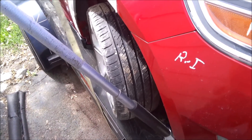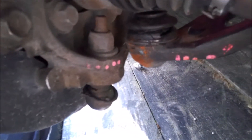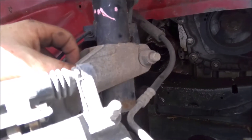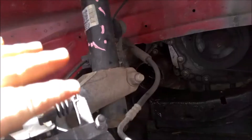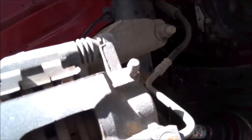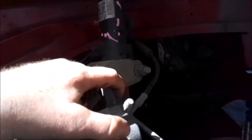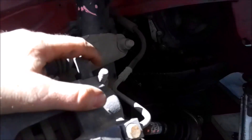Here's the carnage: we got an axle popped out and ball joint popped completely out. Looks like a lower control arm ball joint, axle, probably strut. I'm not sure if the spindle assembly is messed up. What I'll do right now is probably pull the brakes off and this rotor and look behind here to see if I can see anything. It's pretty good carnage.